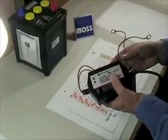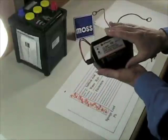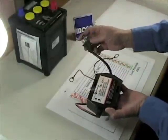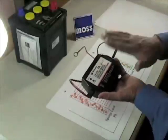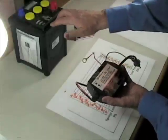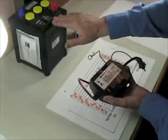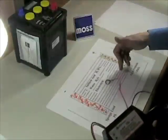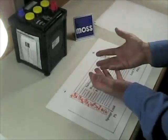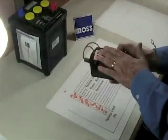It works very, very well. These chargers attach to the battery, and most people find a way to bolt it or hide it inside the car someplace. When the car is going to be stored or not used for a while, they simply connect the extension cord to the plug and the battery charger goes to work. This will put in just enough amperage — just enough power — to compensate for the internal discharge and the parasitic draw that will take place. The battery stays charged, no sulfating can take place, and the battery is good. So if you don't drive your car two or three times a week and you don't like buying new batteries, a maintenance charger is a must for your car.